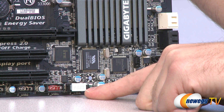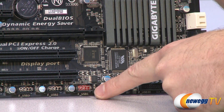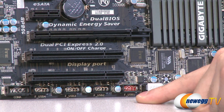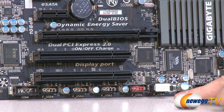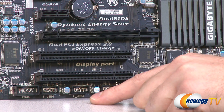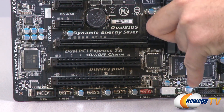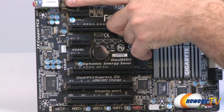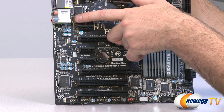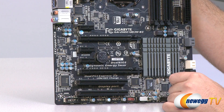Moving along to the left, we can see a FireWire 1394 port, covered with a little cap right now. Next to that, we have four USB 2.0 front panel headers, so you can control eight total USB 2.0 ports with those. On the far left, we have a COM port for connecting serial devices. One more front panel item to mention — right behind the I/O panel on the back — is your HD audio connector, so you route that over to the HD audio on your case's front panel to enable your mic and headphone.